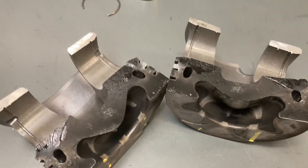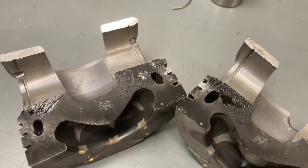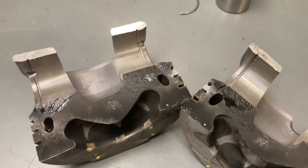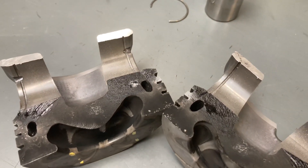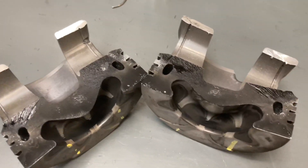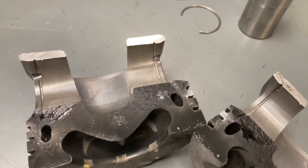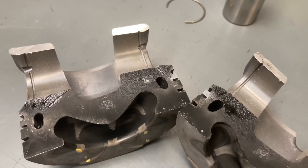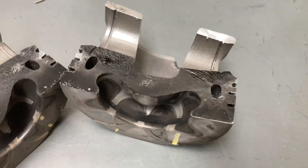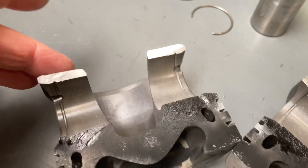This is why it's important — it's well documented by Toyota — that injectors and wrong combustion is what cracks the pistons. So make sure you don't have wrong combustion, keep the genuine Toyota tune, no chips, no remaps, and make sure you replace your injectors before they're causing wrong combustion. From 2009, the 150 Prados and the Hiluxes — the software is really awesome. Even the Hiluxes are still noisy with new injectors, but using the Prados for example, the software keeps it quiet in the 150 Prados, and you can't really hear a thing when they're running right — and even when they start not working right, often you don't really hear anything.